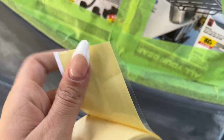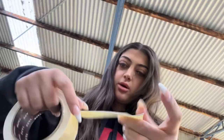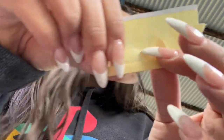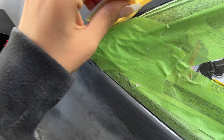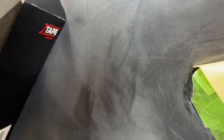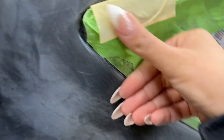There are a couple of different ways you can use J-tape. I find the most effective way for hard plastics is this: I peel it like this — it has little sections that you just snap off, so you've got two little plastic pieces. Then I fold it like this so I have extra strength. I've only got one hand but I slide it in like that — a strong little wedge. You gotta give it a good old wedge. Sometimes it's easier to do it in little squares, but personally I like to do them in doubles. You push it all the way into the plastic as far as you can go, then give it a cheeky tug — that pulls it back just enough so you can get paint in there.